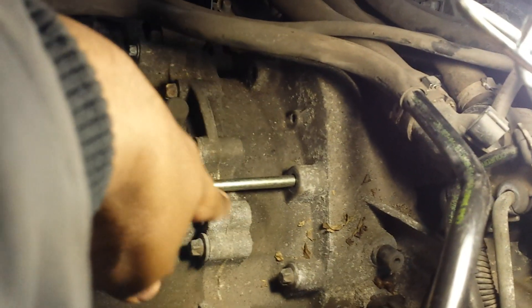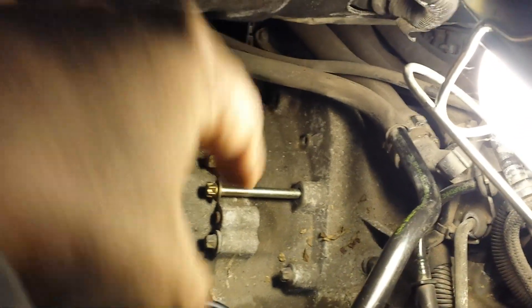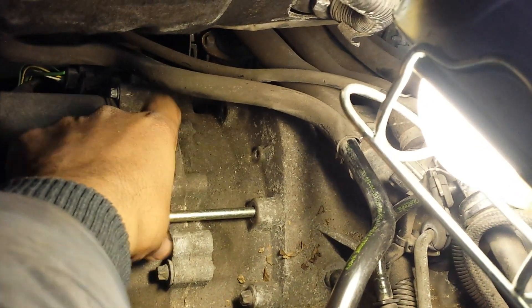Now that I've got access to the engine and the area for the starter motor, the whole point of removing all these components was literally to access these two bolts which hold the starter motor in place. One goes in at the front and the second one goes in at the back. The one in the middle was covered by the plastic housing for the intercooler, so you couldn't get to that bolt without removing the plastic housing first.